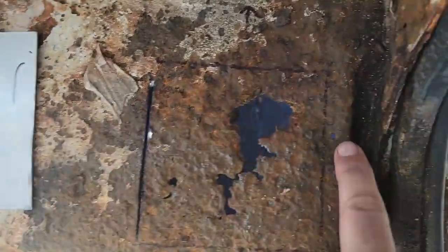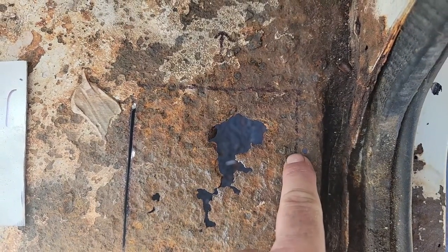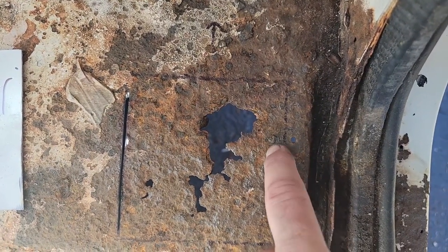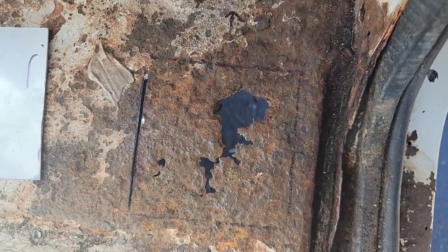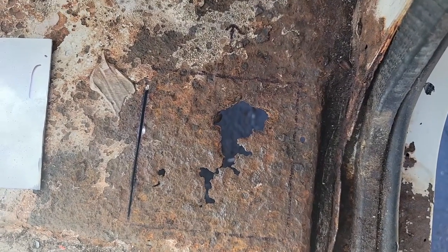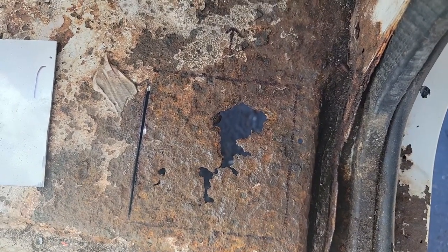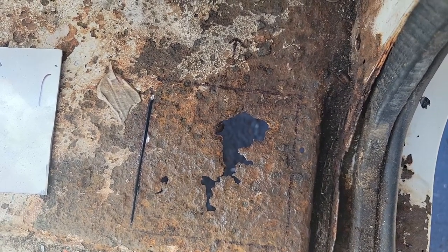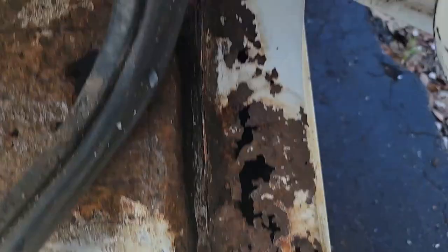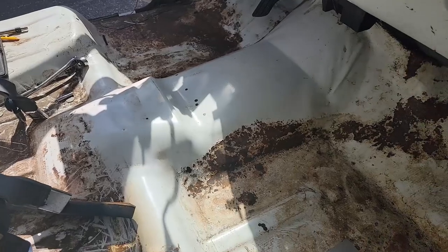I can always drill a new hole if I went wider, but then I'd get into this rolling area here. If I stay over here I keep my hole for the sill plates — it's solid. I don't get into this; I already have to do that over there and that'll be an experiment, so this is supposed to be the easy side. Get it all wire wheeled, then I've got some rust kill — let that sit and then come back and brush on primer. Then a couple other flat pieces like this here will have to be done, with that lip so the new weather stripping can get in there.